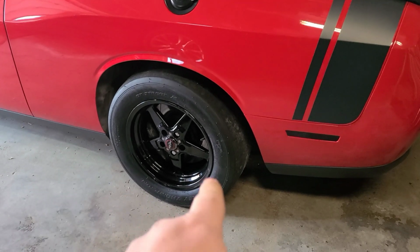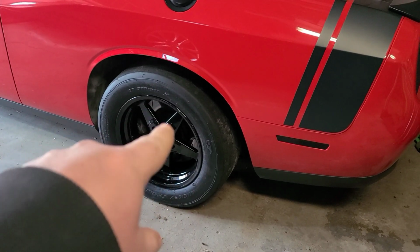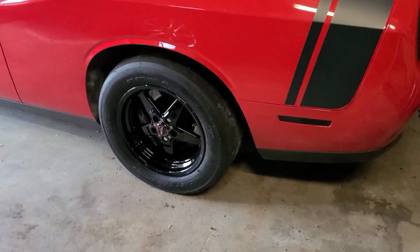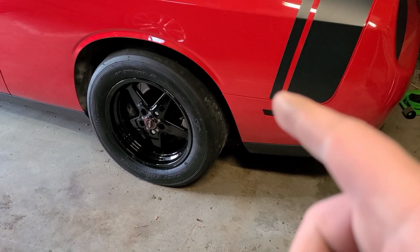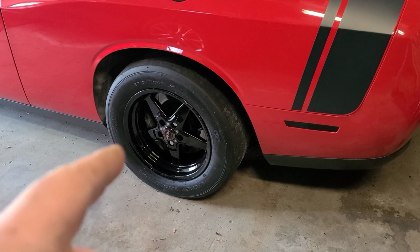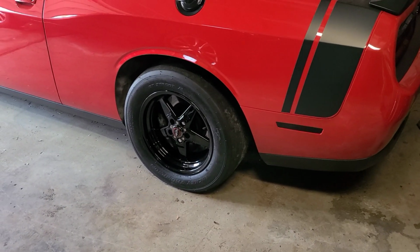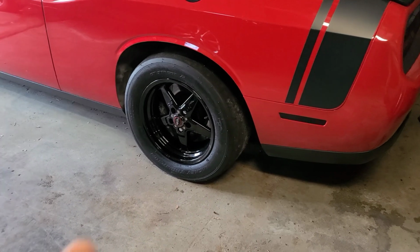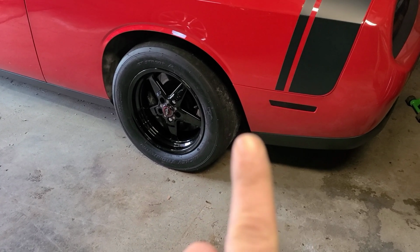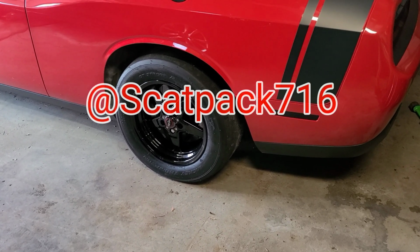Okay, so once we lowered the car off of the jack and got the weight equalized out, the spacing between the sway bar and the wheel actually increased by quite a bit. So it's almost 1/2 inch of clearance between the sway bar and the tire. Based on my non-expert opinion, I'm going to say that's probably plenty of clearance for driving around town and racing. When the weight was pushing up on the wheel, that brings that sway bar closer because there's more weight on this side than there was on the other. So that's why I was pushing together a little bit, but I think we're good.